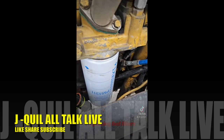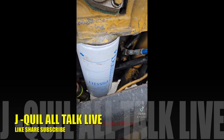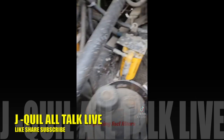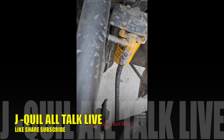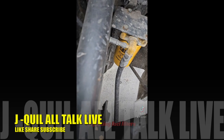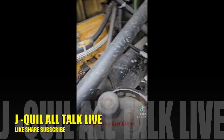This is your fuel filter, right? Part number P551311. This right here is your fuel separator filter, water separator filter. Part number 175-2949. That's pretty much about it. So we pretty much done with this video.